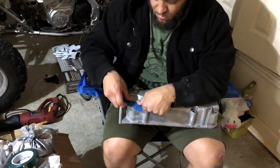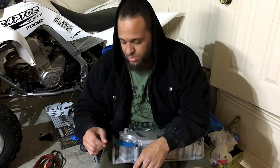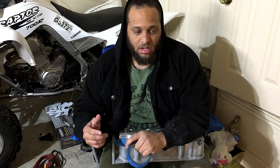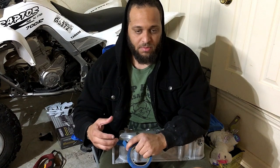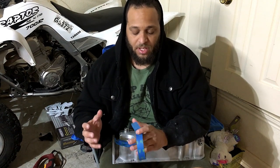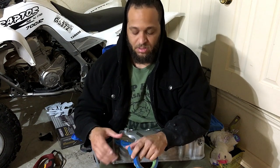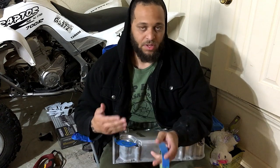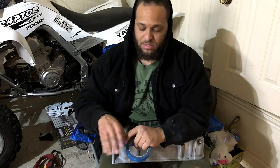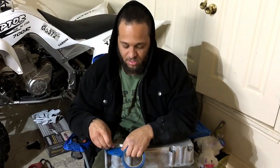Home Depot. So painter's tape, you'll put on, cut out obviously all the stuff you need to cut out, and then once you get it back up to temp, when we hot coat it, because we're hot coating it today, you get it up to temp and we're gonna coat it, and immediately once you coat it, you'll start seeing the powder flow, and then you can take off the tape for the final curing process. All right. With the heat tape, you can just put it back in the oven and you're good to go.